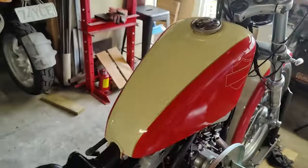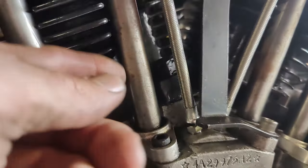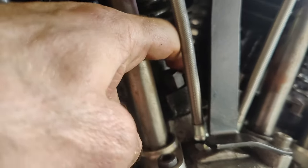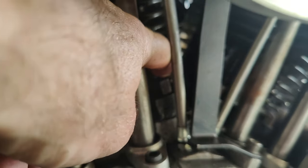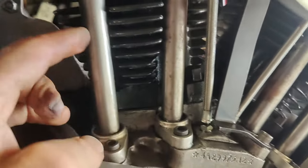Okay. Holy fuck balls. You ready for this? I don't think anything broke as such, but well, let me show you. You see the head bolt? I am pretty sure I should not be able to spin it with my finger. What about this one at the back here? Oh, look. Why is it loose? No wonder the push rods were 2 mil up.